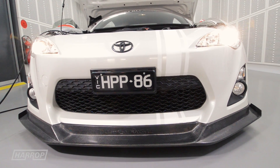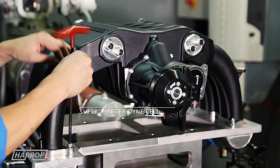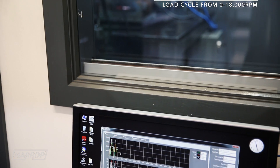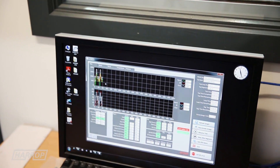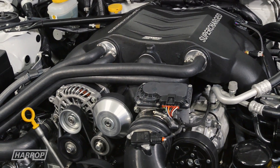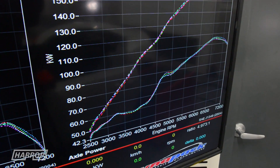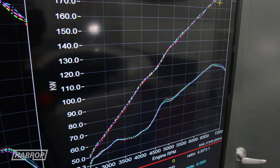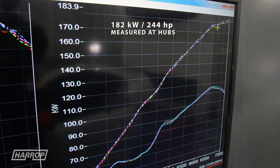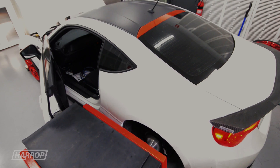Now let's consider the all-important performance. The complete kit with a 95mm pulley runs around 60 kPa or 8.7 psi of boost at 7400 rpm, tapering up from 30 kPa or 4.5 psi at 2000 rpm. The FA20 has variable valve timing on both the intake and exhaust, and large changes in manifold pressure can be made by altering the cam timing. With our emissions-certified calibration, we measured stock hub peak output of 115 kilowatts or 154 horsepower, increasing to 182 kilowatts or 244 horsepower — over 50% on the standard vehicle install with stock headers and a 2.5-inch cat-back system, using 98 premium unleaded.